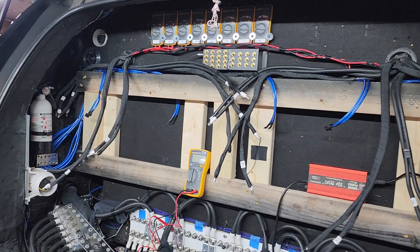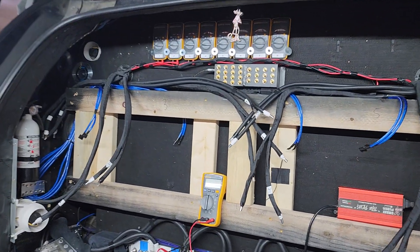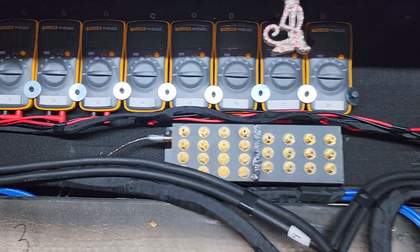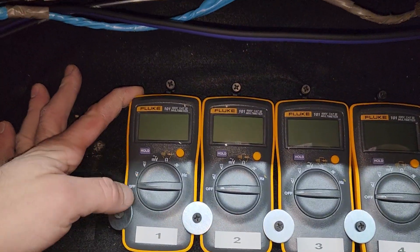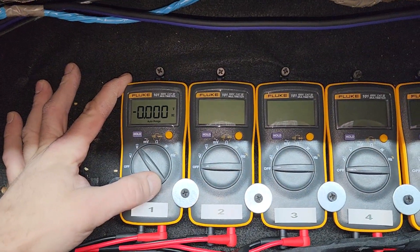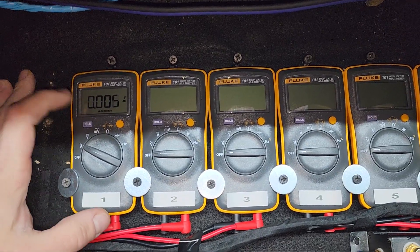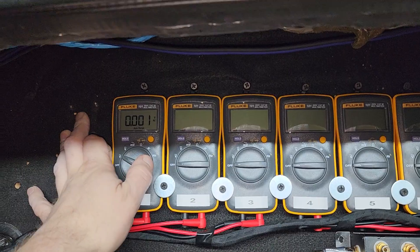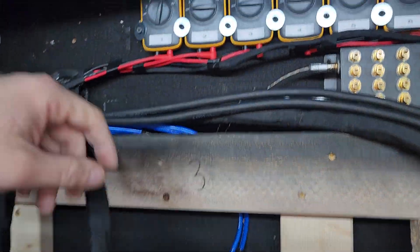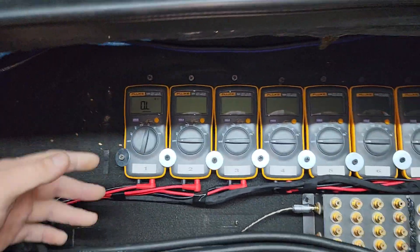Any other questions hit the comments, but the main comment I was getting is why I run these meters on here. This is just a basic Fluke 101. We got DC voltage and AC voltage — the AC voltage is the main one I use when you're doing amp tuning. Then obviously you can come over here to check your ohm load. Nothing is hooked up right now, no subs in the box, so the ohm load isn't going to read anything, but you could check ohm load without pulling a meter out.